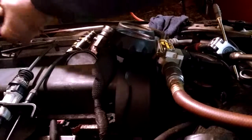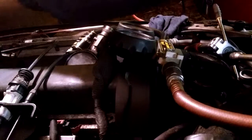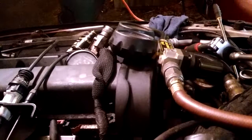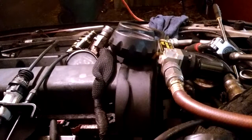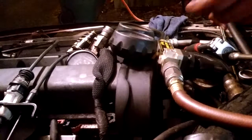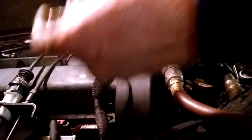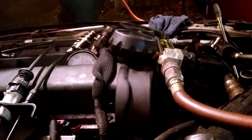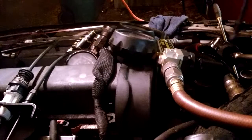And now, the adapter usually stays on the compression hose. Now we're going to take the adapter off the compression hose. Put on the leak down detector hose. So you're not supposed to switch hoses, I don't know. The leak down detector probably can take a little more pressure or something. I'm not going to mess with it. Screw it in as tight as you can. Oh, actually, you know what? We forgot one step.